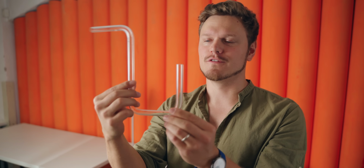So guys, my first hardline tube is complete, thanks to HP for all the valuable information that goes into making this possible. The actual process is fairly simple in terms of heating up a certain section that you need to bend and making sure that you heat up the sides as well. But then you understand the complexity of making sure that the bend is properly complete and everything aligns to where you need to align, because you don't have much wiggle room. And you really appreciate all the guys who do water cooling and do really complex bends that go in and out of a system. So now it's time to show you how this is done and actually start to do our tubes for this sick build.